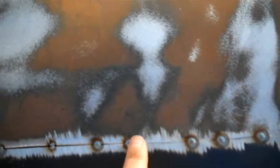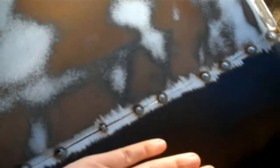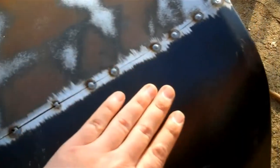But here on an exterior panel, you do need to jump around. Turn your welder down and jump around, just spot welding, little bits at a time. That way you don't get too much distortion. Right now this panel is pretty darn smooth, and I'm real happy with it, except for this edge. You can see here it's not lining up there.